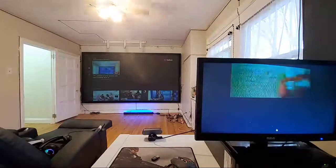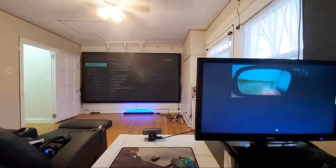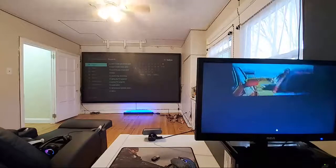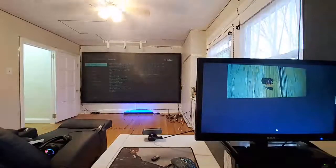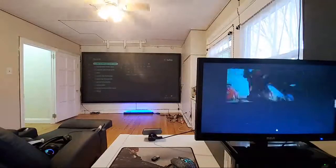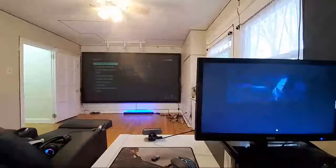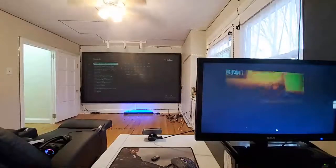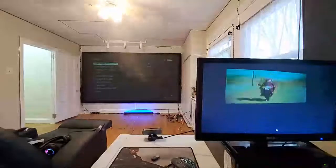I suggest before you go out and spend the money on our screen paint, you basically map out your environment to see exactly how much room you have. And then from there, go to Projector Central and see exactly what kind of screen you can have. People make that mistake all the time. They'll look at their wall and estimate the size of their screen, and then they'll get the projector over there and find that the projector cannot fit the screen, because you may need ultra short throw, short throw, or long throw, depending on your environment.